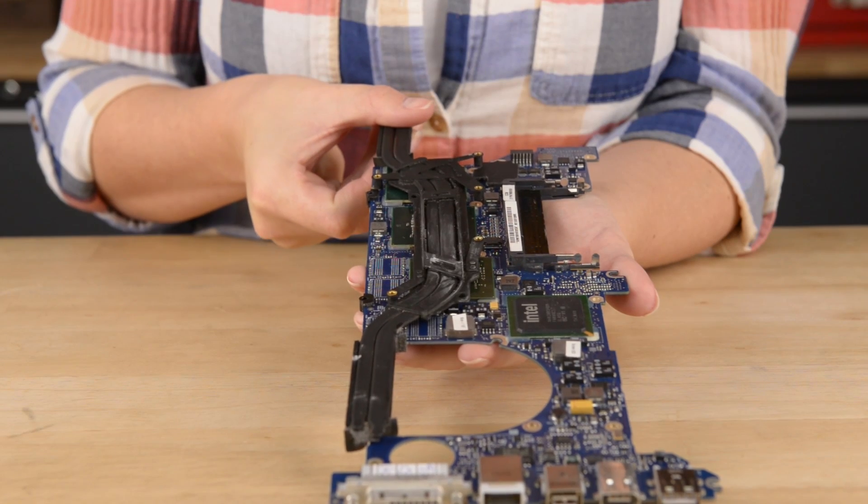Use your finger to gently smear the thermal paste over the entire processor's core. There's no need to add paste to the heat sink too — the paste on the core should be enough for a great seal. Finally, apply your clean heat sink.